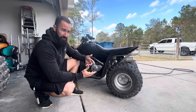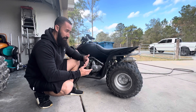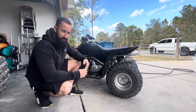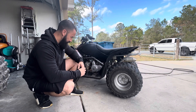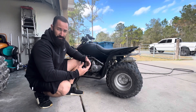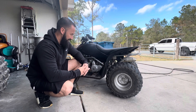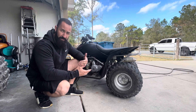It's going to prolong the life of the engine, because on these motors the top end is kept cool with fuel. So if you don't have enough fuel and it's too lean, you're going to run the cylinder hot and run the risk of burning a piston or needing a top end sooner because it's not being kept cool by the fuel. So just best case scenario, even if your machine is stock - these are very lean from the factory - it's always a good idea to bump up the jets just a little bit, just one size, and it'll make the machine run better, more responsive, and it'll preserve the life of your machine as well. Thanks for watching guys. If you have any comments, concerns, or questions, feel free to drop a comment, make sure you like and subscribe. We'll see you guys next time.